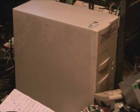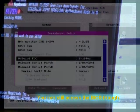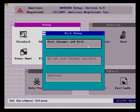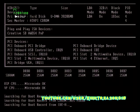Once at a LAN party I saw a man using the P6DGE — this motherboard's brother — and he was triggering a capacitor with a relay across the PSOn line so that the machine would turn off if the alarm was triggered. Strangely, AMD used a similar method in some of their Athlon processors. There's a lot to play with in the BIOS though besides setting noisy alarms off. If you're running XP the power management section is completely useless as it doesn't work properly with this OS — it just ignores it entirely. The machine won't even wake on LAN when running Windows XP.